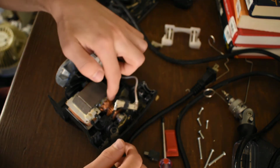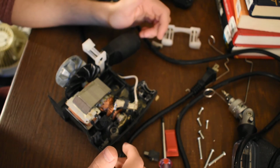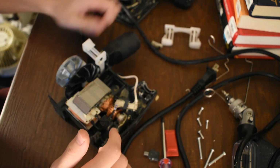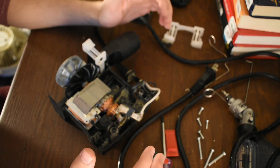But it's going to die because the wires are going to come off the commutator bars. That seems pretty obvious to me. This is the failure mode. This is what's going to go wrong first, with any little bit of vibration for any extended period of time. I mean, it hasn't broken yet. I'm almost sort of shocked that it still works.